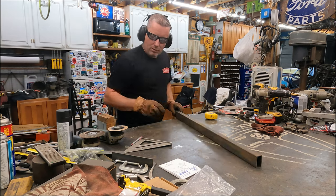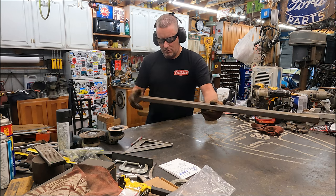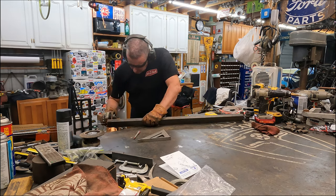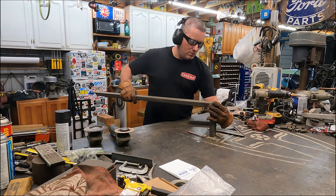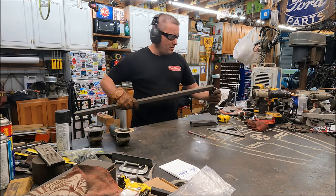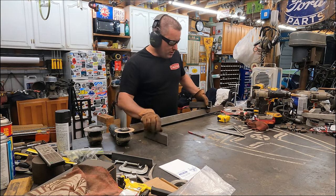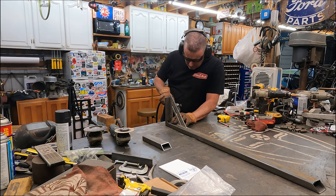Okay, we're gonna cut 45s on the ends. We're gonna run it flat like this, with a leg down and a leg angled to it. We're gonna cut the ends at a 45. Nice clean edge on there. Okay, dokie. Here we go. That's gonna sit like that. Then, since I need to have 37 inches wide, I'm gonna attach one side, then I'll adjust this one to fit 37. That's squared up in there. That's good.